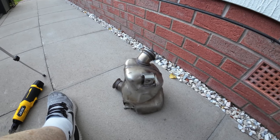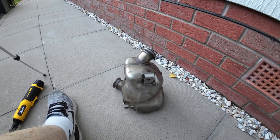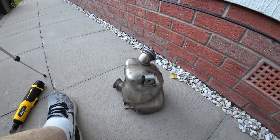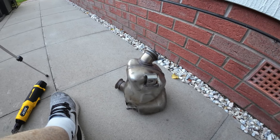We're going to now get this link pipe in. Hopefully it'll be a bit easier than getting that one out because it was a right pain. You've got to be on your back getting the side off. You'd do it easier higher up on a stand, but for me I had to use the centre stand — if I used my ABBA lift it would be in the way and I wouldn't be able to get it off.